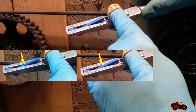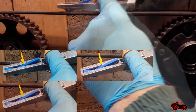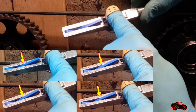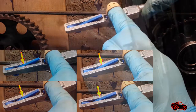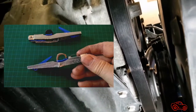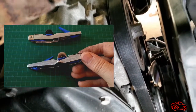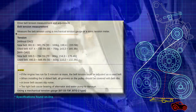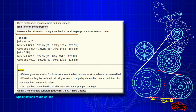The 12-inch span setup was also done with the same static load reference. At that time, the average readings with the same gauge were around 182 pounds — only 1.6% less than my static load reference. Because I had to use my cricket gauge on a short 7-inch span, I simply revised the gauge readings by adding 10%. I was able to set the tension within the specifications recommended for the new drive belt installation, using the belt tension references for an alternator pulley without OAD.